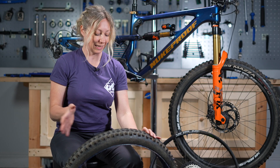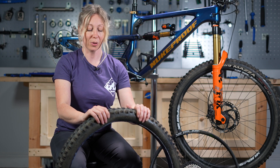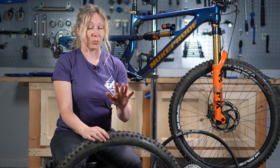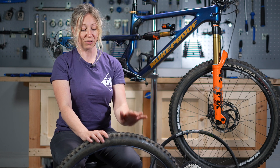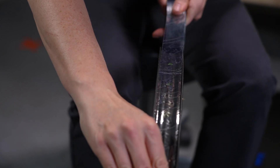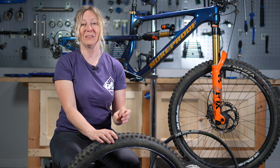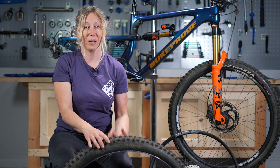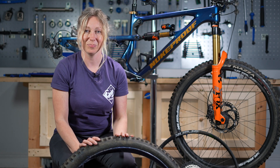It's all very well having new sealant, tape, and valves, but if your tires are in bad condition you're probably going to lose air and suffer punctures anyway. Make sure you have a tire in good condition — not too many holes fixed with tire plugs, and not so baggy around the rim that air is escaping between the rim and the tire. If you're reusing a tire, try my trick of running the tape around a couple of times to create a better seal. Also make sure old sealant has been taken out — it might be too old to work, contaminated, or if it's two different brands they might not mix well. Make sure the inside of the tire is clean and dry, with any gunk or old dried sealant removed from the edges.